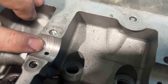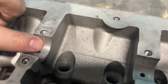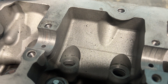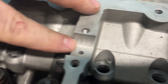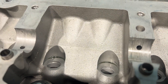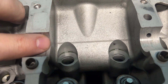If you look at these cam journals, these things have been hit pretty hard. This looks like either oil contamination or lack of oil — something's going on here. This head's also been bead blasted, so somebody rebuilt it before. All the cam journals have this dull finish because it's been bead blasted, and maybe there was some junk left in the head and this is what we're seeing now.